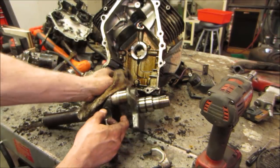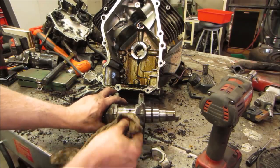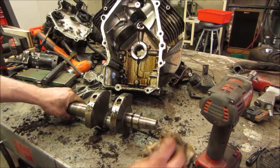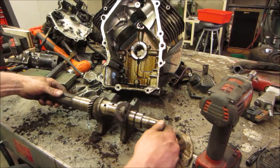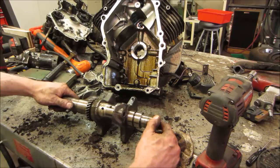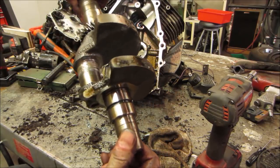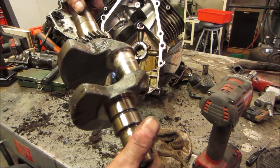And the oil pressure comes in from the center of the crank. Oil pump, I should say. Pumps oil in, there'll be a hole right there. And it pressurizes that port. And then also goes up to probably the cam too. Yeah, I don't see any bluing at all. Any signs of like overheating. I see where it let loose and all the aluminum is stuck to it. But I don't really see where it got cooked.